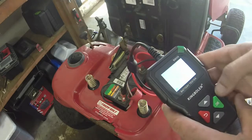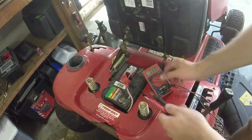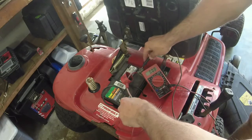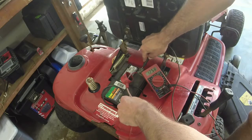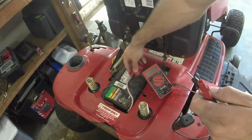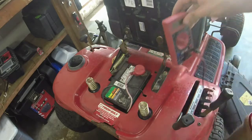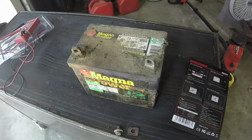Let's go test a bad battery and see if it'll even fire up. While I'm here, I'm checking with the multimeter just to see how accurate it could be. The analyzer said 12.43 volts and the multimeter is showing 12.56, so it's definitely in the ballpark. That multimeter may actually be less accurate, but I just wanted to show you all that comparison before we go to the bad battery.